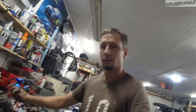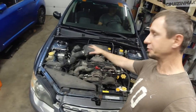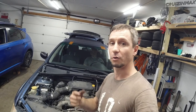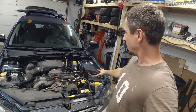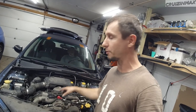Guys, we forgot something. Seriously, we forgot the exhaust valves. All right, so we had the battery on charge. We finished up, as you can see, we let the starter cool down. We cranked it some more, made sure there's oil in the filter. There was, you know, ask me how I know. And the starter cooled down, we cranked it a little more, and we finally got that red light to turn off. So now it's primed.